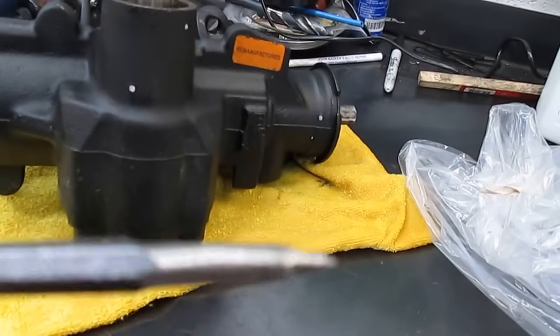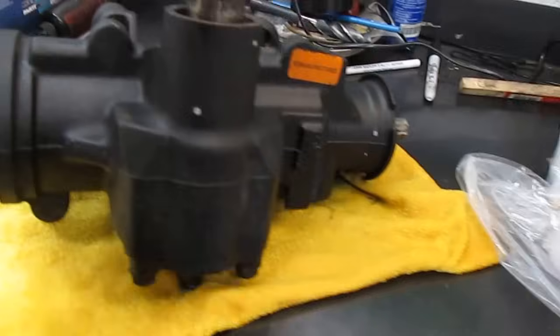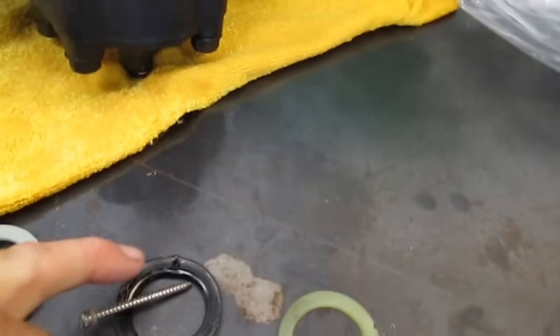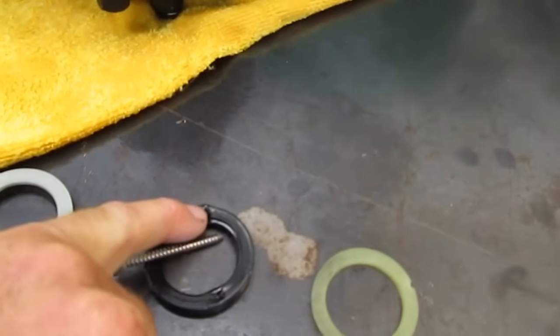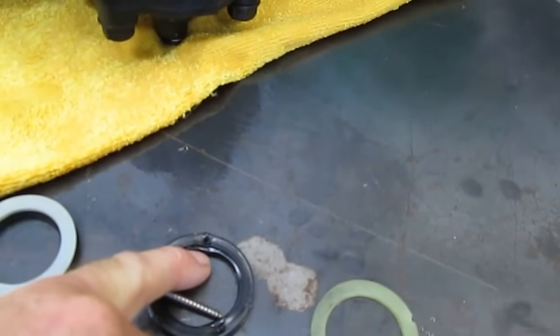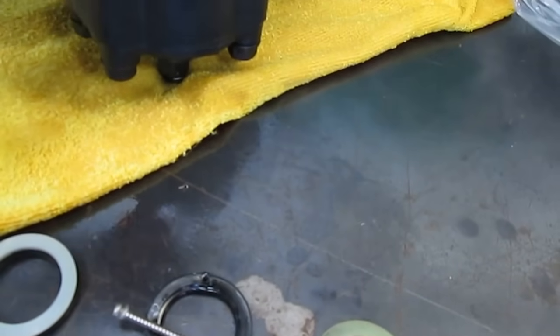and just work it around so it'll fit down in between that space. And be very careful that you go in the middle part of the seal, that you don't make any center punch marks that are going to damage the shaft or the housing on either side. So I want to pass that on because I know I'm not the only one that has that problem. Some people do these right inside the vehicle. I choose to just put it on a bench where it's easier to work on it, then reinstall it back in the vehicle.